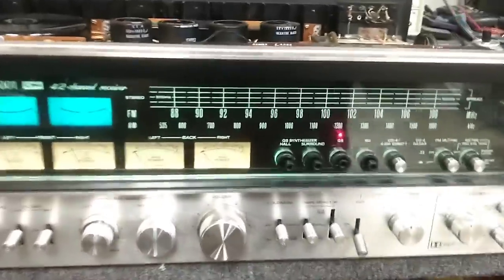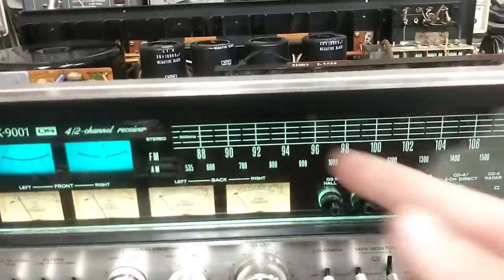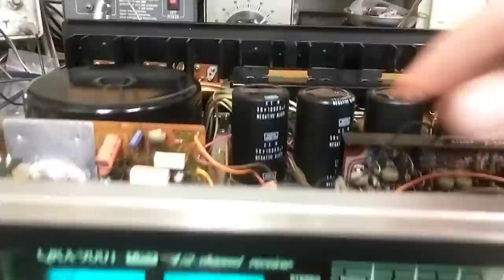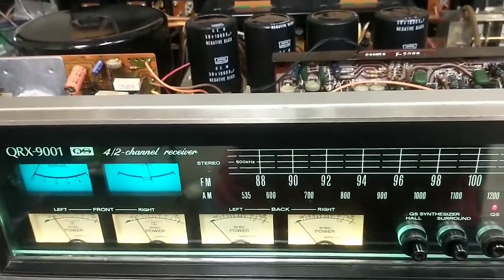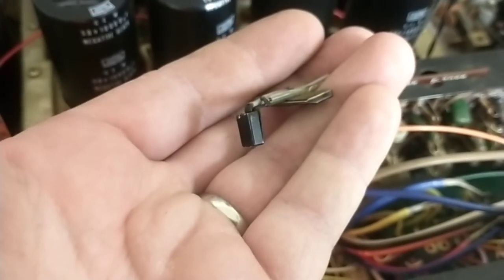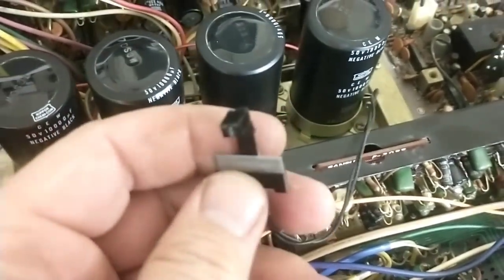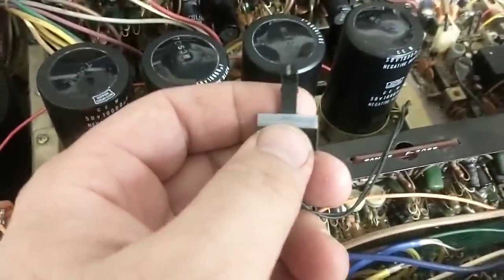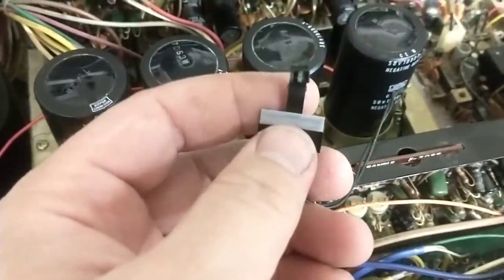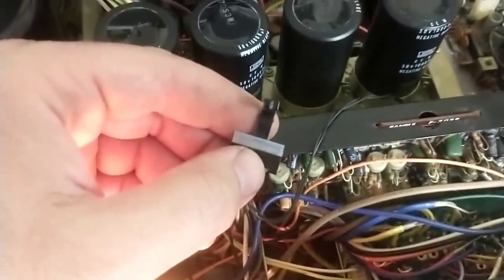So now what we need to do is figure out the dial pointer. It's a black background with a little squiggly opening here — the dial pointer is supposed to be completely illuminated. But unfortunately, according to the owner, the dial pointer got broken somehow before it arrived here, so we need to come up with a solution. Here's the dial pointer assembly and as you can see, it's missing its little plastic diffuser. I have a couple of dial pointers, but I don't think they'll just be a drop-in replacement because of how far this hangs over.